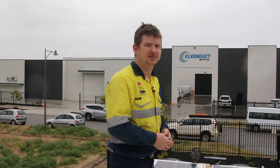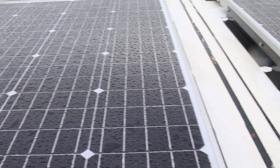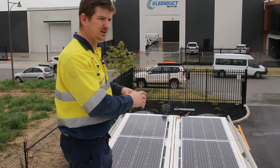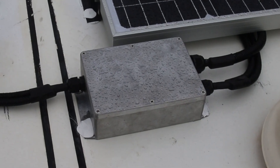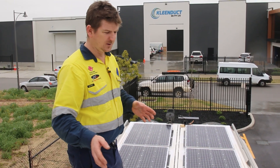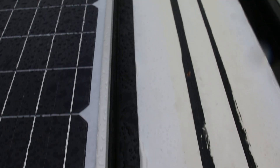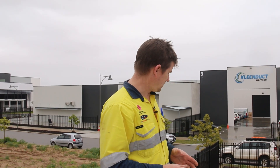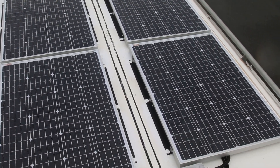As you can see, we've got four 120-watt panels here on the roof, all connected two in series and two in parallel, connected into a junction box which has gone through the roof — all fully sealed. The customer mentioned a lot of problems with water leakage through the cab, so we've made a big effort on sealing everything with Sikaflex 221, making sure it's all nice and clean.